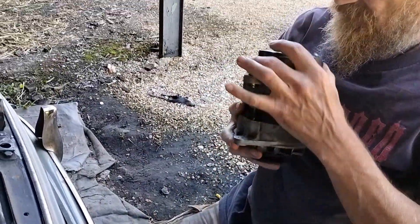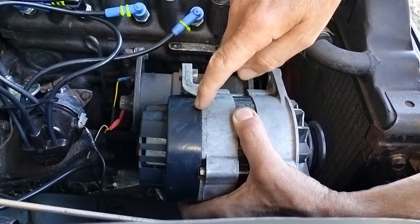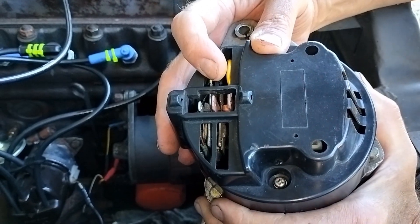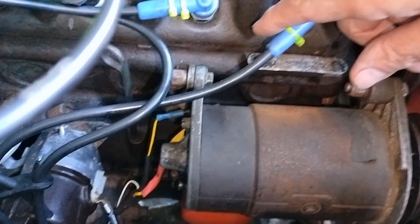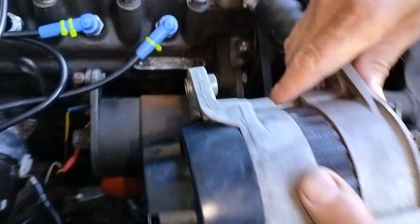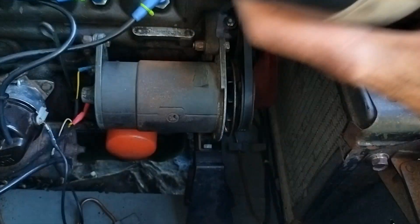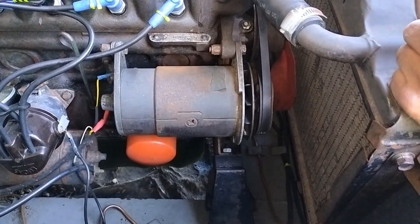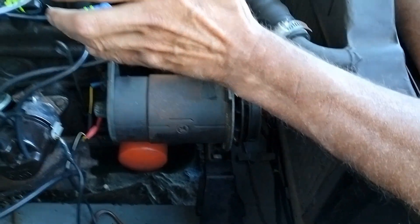Here's an alternator to compare. As you can see they are very different. The alternator has a big lump of plastic on the back, usually connected with a three-block connector with three wires coming out — sometimes two. A dynamo usually has one fat wire and one thin wire coming out the back. You can also get dynamators, which are alternators disguised as a dynamo, basically to make your engine bay look more original than having a modern alternator in it.